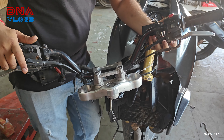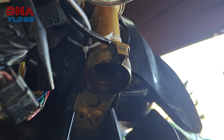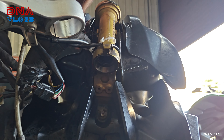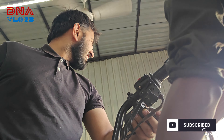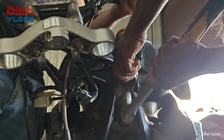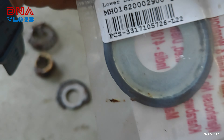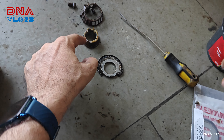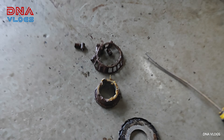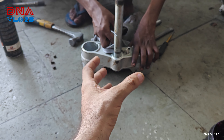Amit is going to ride the bike the other way around. We're greasing the bottom part first and then putting in the base of the bearing. While taking the bottom oil seal cover out, all the bearings had stuck in the T so we had to hammer it out. This is how the bearing came out — completely rusted and jammed. That is the reason the bike was getting stuck at one location.